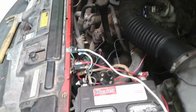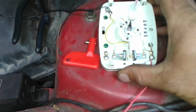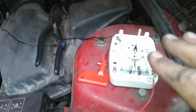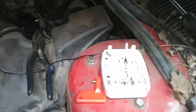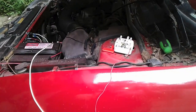When the diaphragm pulls the arm off the switch, it cuts power to our added starter relay and then the starter kicks back out. So the engine will sit there and run until the thermostat tells it to turn back off. The car is turning on and off with the thermostat. Now all I have to do is figure out where to mount this inside the car, run the wires, neaten everything up, and we'll have our system set up.